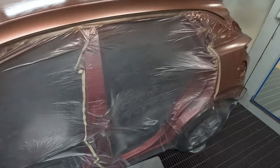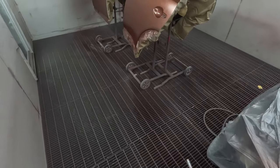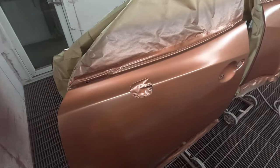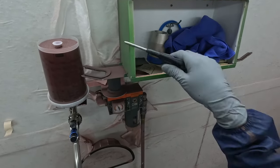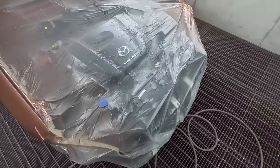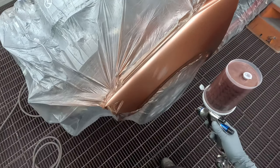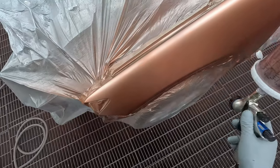So the rest of it did look pretty good. But yeah, it's worth inspecting every time you're putting a coat on, just watch what you're doing. Now, when I do sand them down, I've found you're best off putting a nice wet coat of color over it. That's just what I've found works better. If you just try dusting it on, you've got to put so many coats on, but to fill up those 1200 grit scratches, I've found you're best off doing something like that.